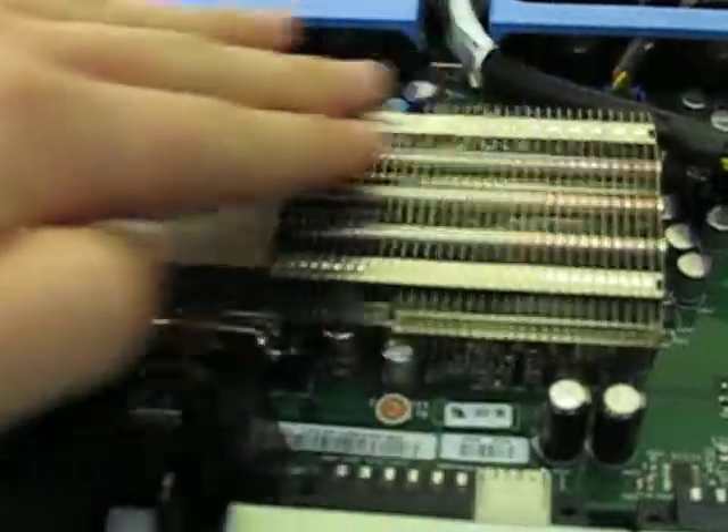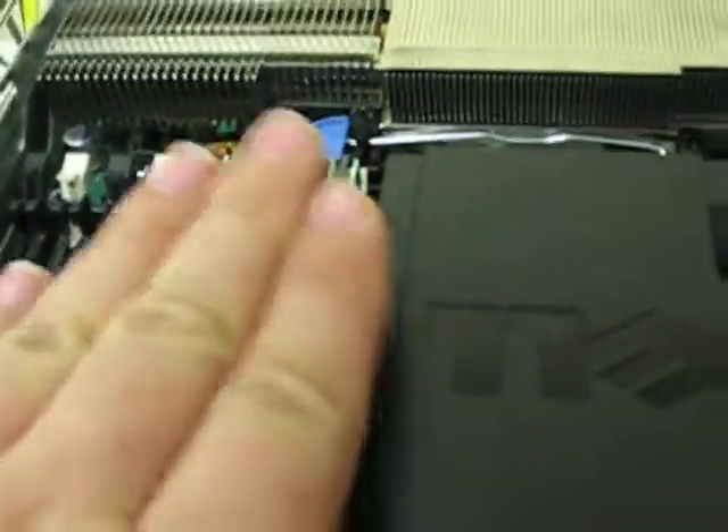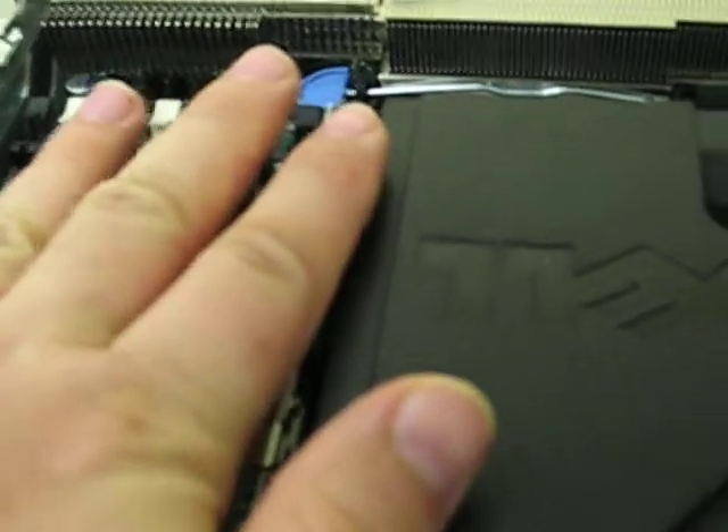If I put my hands here, I can really feel the air coming off, blowing over the top here. These right here are the CPUs, so there is some air getting over the CPUs with the cover open. But right here there's an air duct that passes through, directing air through channels. There's really not much airflow down here. The memory is also designed to have the air forced across it, but there's really not much airflow reaching it. Nice warm memory right here.